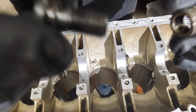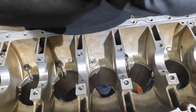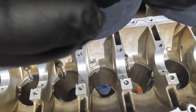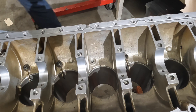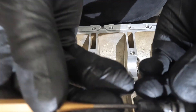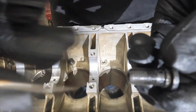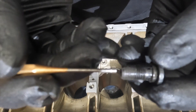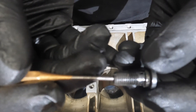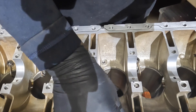So what we have — the screw goes into here and then that gets put into here and torqued down. This is a pressure relief valve, so you want to make sure this is clear of any debris. Using a small screwdriver, you can release the ball on the inside to make sure it has resistance and goes up and down. When the oil comes in, this should relieve the ball on the seat of this pressure relief valve and allow the oil to spray into the pistons through the nozzle right here.